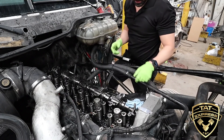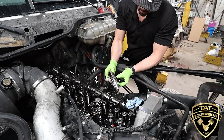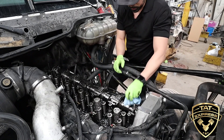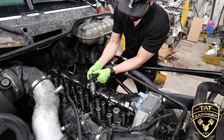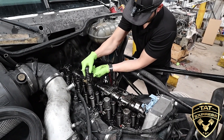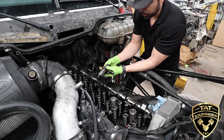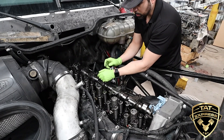I've got the injectors popped loose, so I'll start pulling them out. Here's number one — as you can see, everything looks good on this injector. We're going to be replacing all the O-rings, but I'm pulling them to see which one could be giving us our problem. There's number two — those rings look good as well. Pull number three — and there you go, see a busted O-ring there. Number three's O-ring is completely gone; looks like it may be just gone all the way. So there's going to be our problem right there.